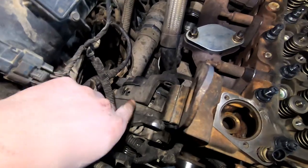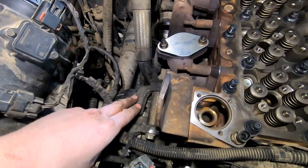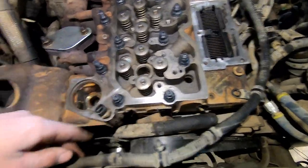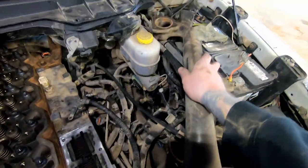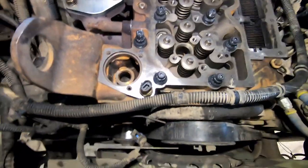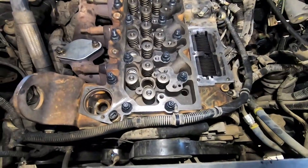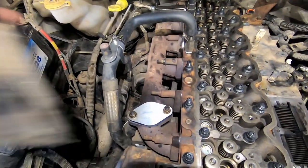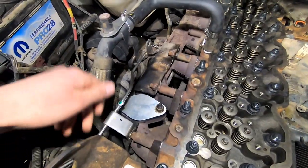That's all done. Now pivot your alternator back on, bolt it back up, and put your belt on. Once the alternator is back on with the belt, reconnect the grid heater wire and the other wires — bracket there, bracket there — and zip-tie them back up. Leave the upper rad hose off for now because it'll be easier to see down in there when doing the valve set. Get all the wiring mounted and strapped back up. Don't forget to slap the heat shield on your exhaust manifold. The exhaust pressure tube is in there loose, and the electrical is all tied up.